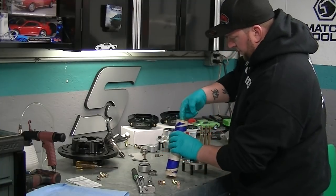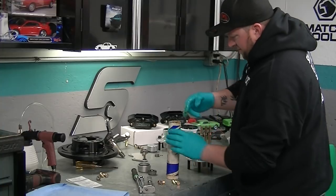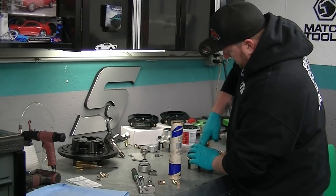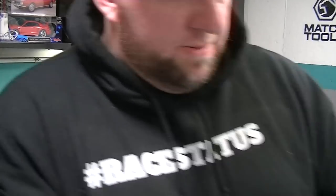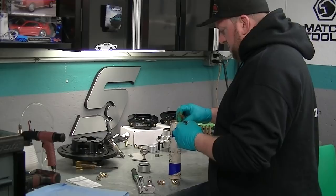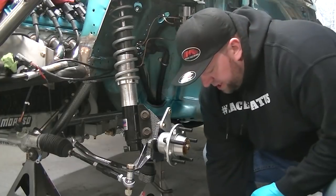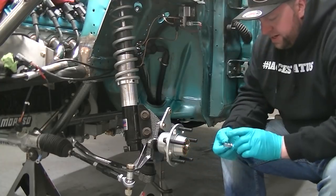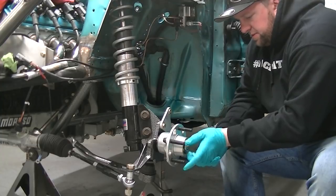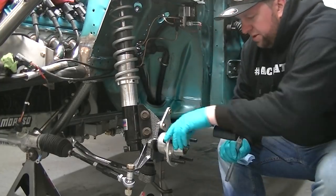There's a little channel in the hub - you want to fill it up with grease. This is not something you want to skimp on. You want these well maintained and everything well greased. Stick that on the spindle with your front bearing. Remember to pack the front bearing the same way. So with your rear bearing in and axle seal installed, you fill the hub with grease, get your front bearing in, and then assemble your spindle nut kit.